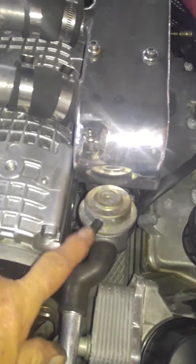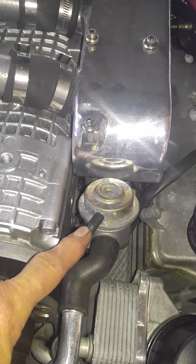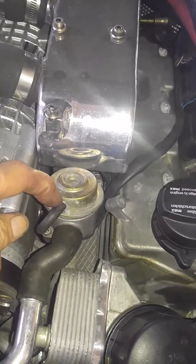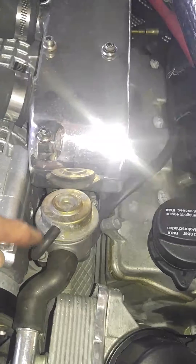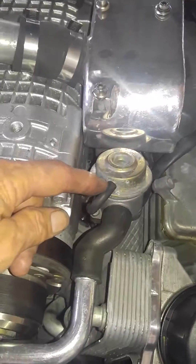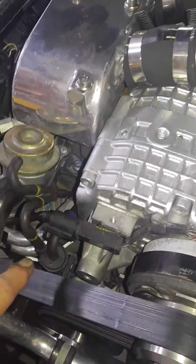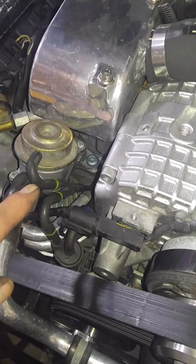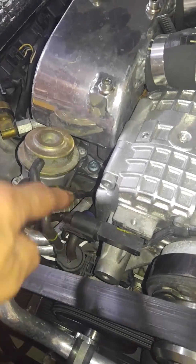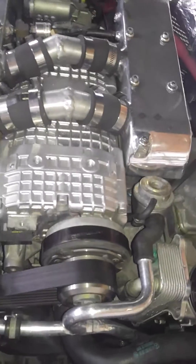So if you want to check your P0410, put a vacuum gauge on here and verify when the engine is cold that you get pressure going through the smog pot. You'll see a vacuum signal here — you can use a T if you want — but it's important: if you don't get vacuum here, the hose is either bad, the solenoid is bad, or you have a problem with some of the piping. This pipe goes underneath the supercharger and if it fails you'll never see it. It'd be a real monster to fix.